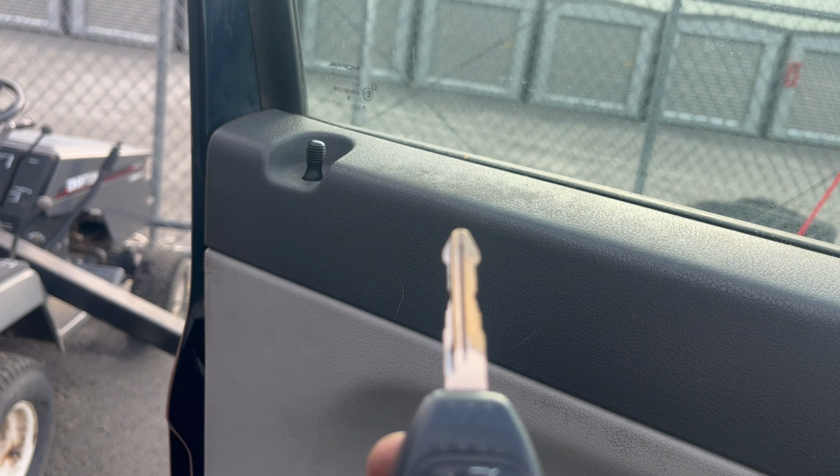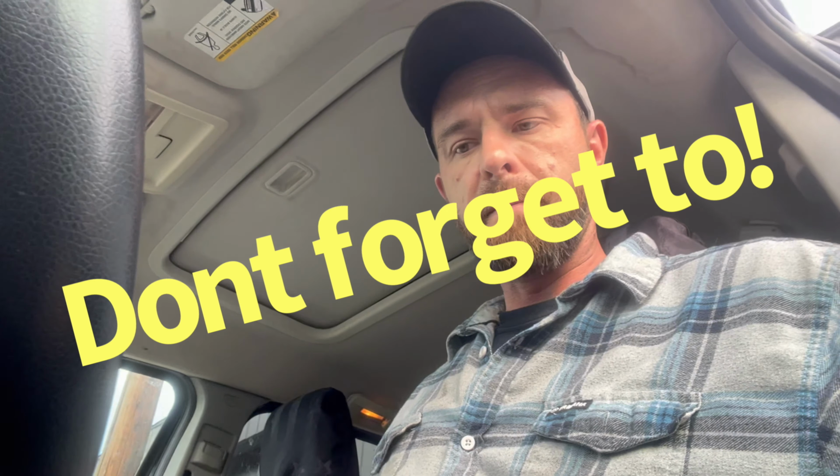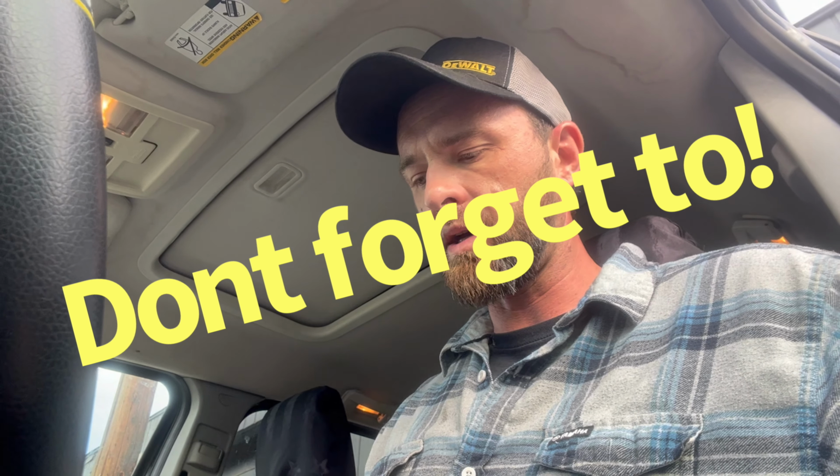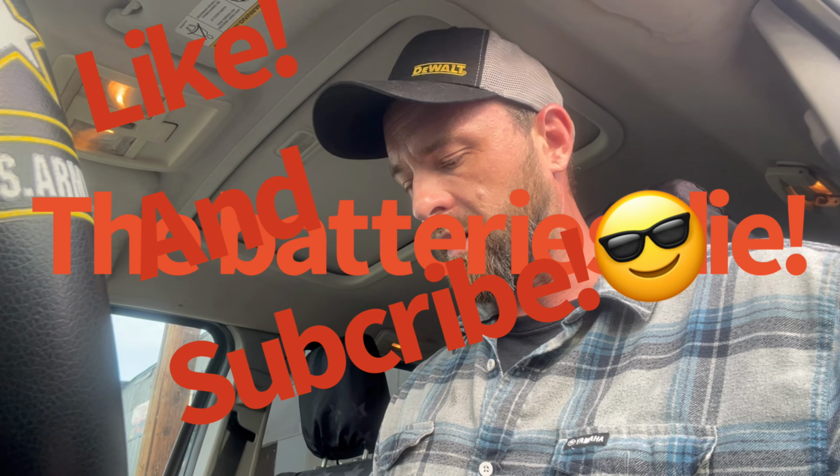So as far as that WCM, if you guys remember, the door locks weren't working on the fob. So there you go. That TPMS light, it just happens to be on. That's just going to be an unrelated issue. I just rescanned it, and there's no codes in the WCM. That TPMS light is just telling you got low pressure, so better fill her up. And then, well, probably the sensors are bad. They always are. Unrelated though, so I'm happy with this. Customer's going to be happy. They can drive their car. They can start the car, drive it. They can unlock the doors, so we're good.